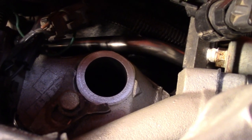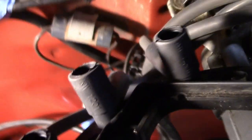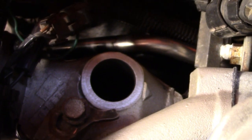If you're coming at this blind and you haven't had a chance to write things down, the main thing is the wiring harnesses. Here are the connectors for the distributor. I know where the wires have to come because they're already laid out, and my shortest wires are the ones that go down the back of the engine behind the block, and they constrain it. So the distributor can move a little bit, but I know that pointing it basically square to the world and out the front is the way to go.